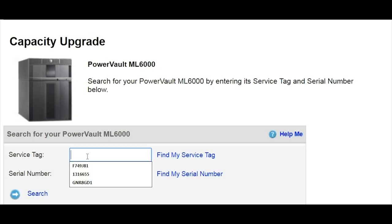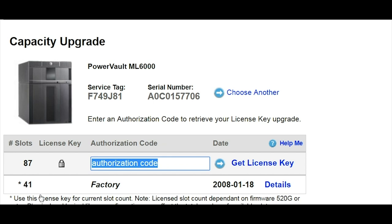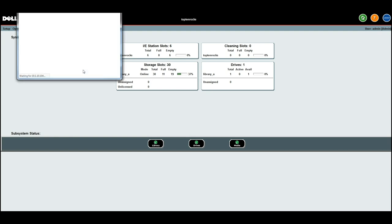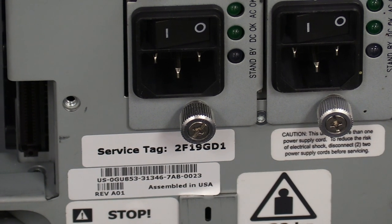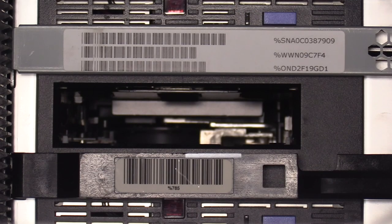At this point, you have very likely concluded that you need a replacement control unit because you have replaced other components within that control unit and they have not fixed your errors. The first thing that needs to be done is to check the licensing on your machine. The licensing for any ML6000 control unit can be checked using the link in the description to the Dell website. The two pieces of information you will need are your library service tag and library serial number. These can be found via the web GUI library information window, or on the physical machine itself — the service tag on a sticker on the back, and the serial number on the barcode inside the machine visible when the main access door is open.